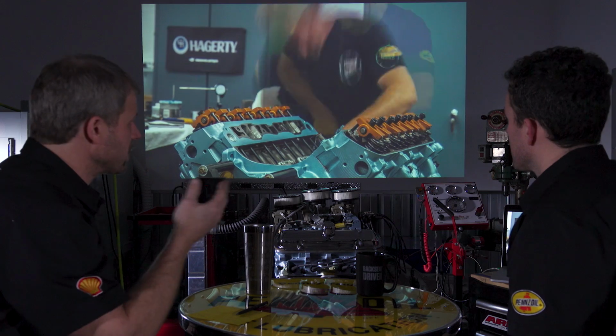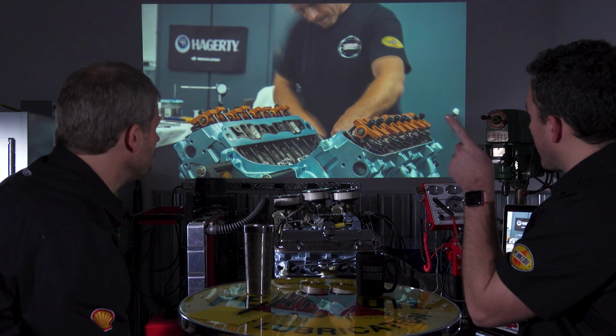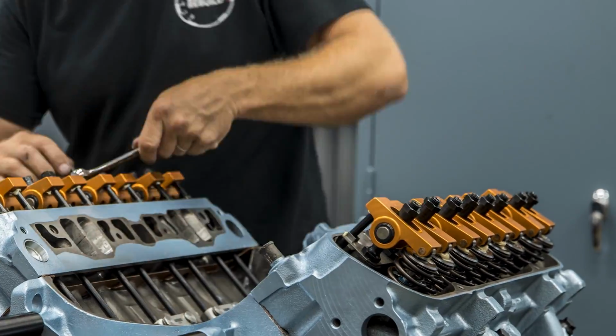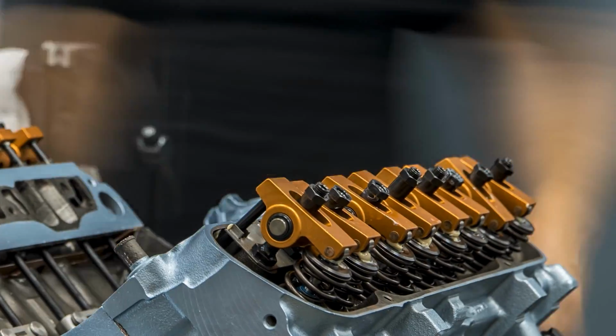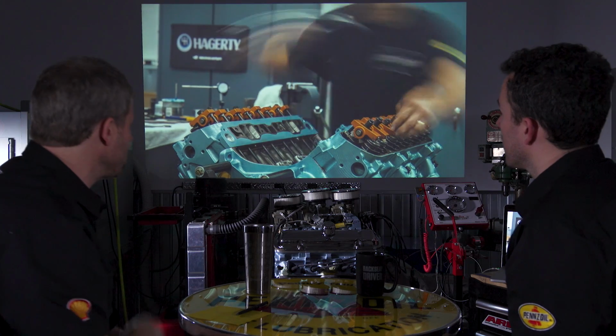So instead, factory would use a pinch nut. Oh yeah, you can kind of see them start disappearing down in as you adjust it. What are you setting here? So you're obviously rotating the crank because you can see all the lifters moving. So here I'm adjusting lash.